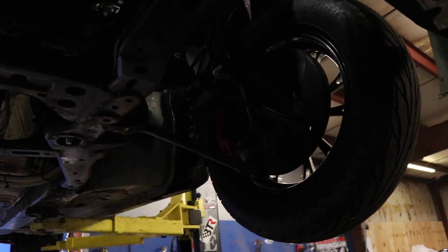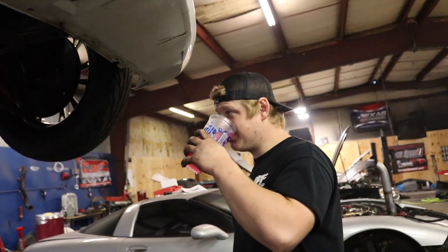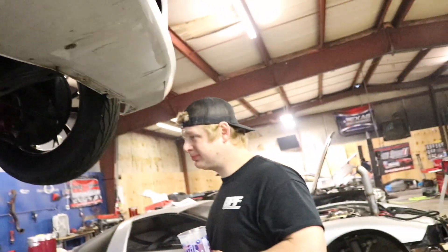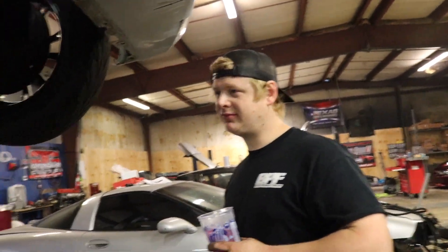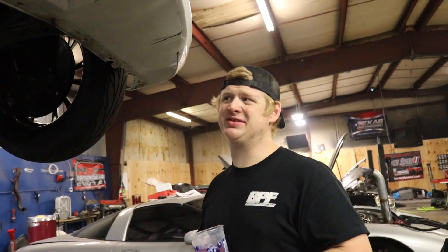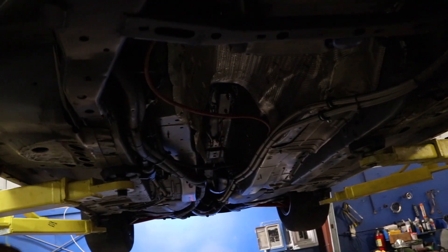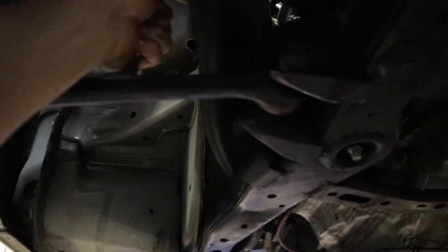The consensus at the end of this video: if you have a 5th Gen Camaro — and we're just talking about 5th Gen Camaros, the Mustangs and Corvettes are different monsters — these are probably one of the hardest cars to get to hook. CTSVs are different monsters, they hook up a lot better. The 5th Gen Camaros with factory IRS struggle to hook up. What you need to do is first go buy the whole BMR catalog, get some Strange coilovers in all four corners, and get these travel limiters.